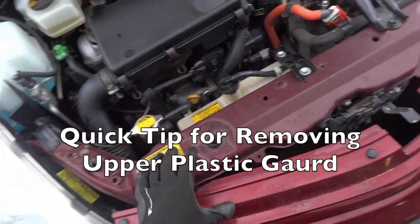I'm going to reuse my coolant. So I'm going to start draining — loosen this petcock. You should start to see the pink engine coolant draining, not the inverter coolant. It's going to be kind of slow. Now's your time to go to other prep. You need to remove this black panel — there's a million videos about this little black plastic thing.